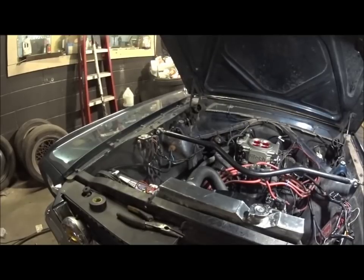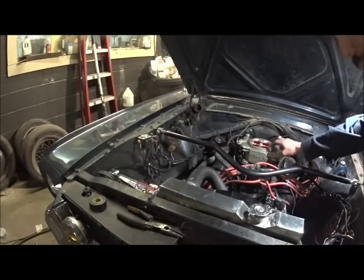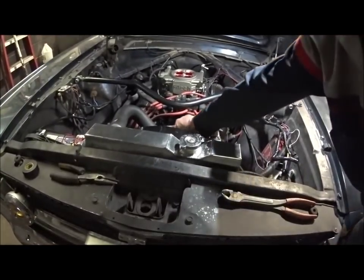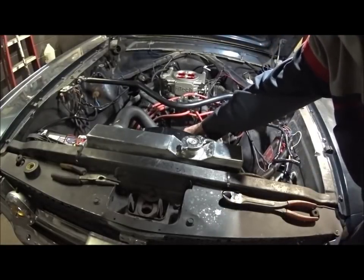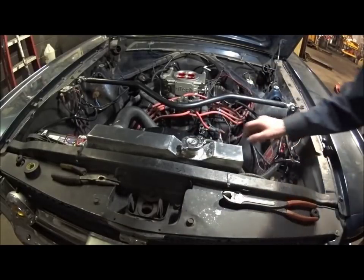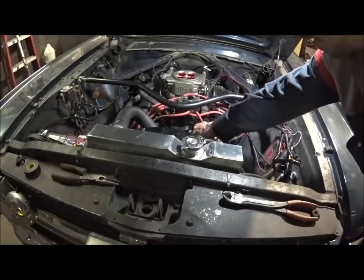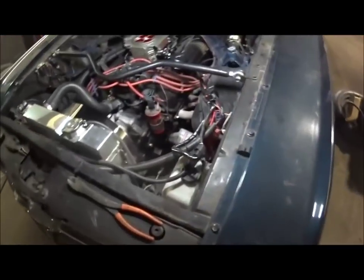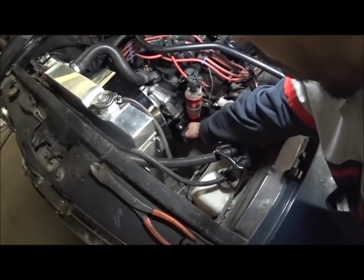The air cleaner does fit on top of the stock throttle body — it clears everything, so that's all set. The coolant sensor is here. I had to change the thermostat housing because I needed one off of a Lincoln that would have the threads to put the coolant sensor in. I couldn't put it in the intake because that port was already taken by the gauge sending unit. And the original fuel pump is gone — you don't need it anymore. This is the block-off plate.